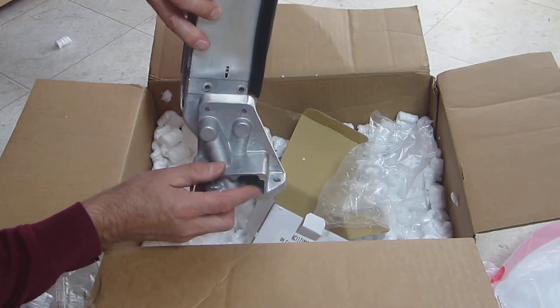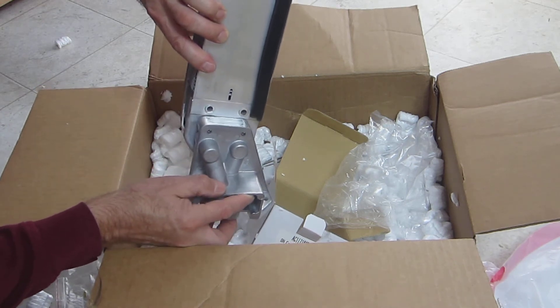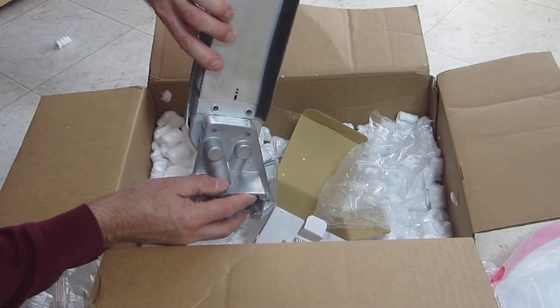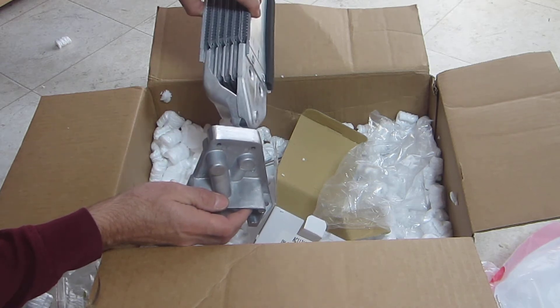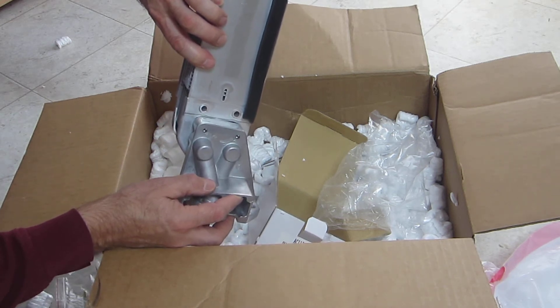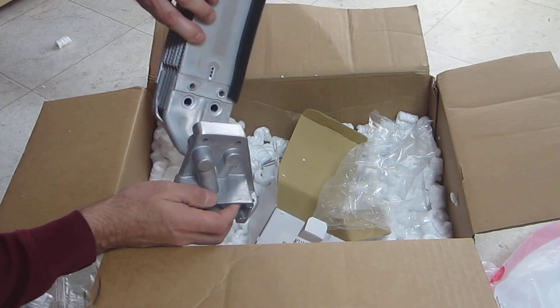The number three cylinder, which suffered overheating in earlier non-doghouse cooler setups, gets a greater amount of airflow with this doghouse setup. That's one compelling advantage to going with this 2332 using a doghouse and a full flow setup.